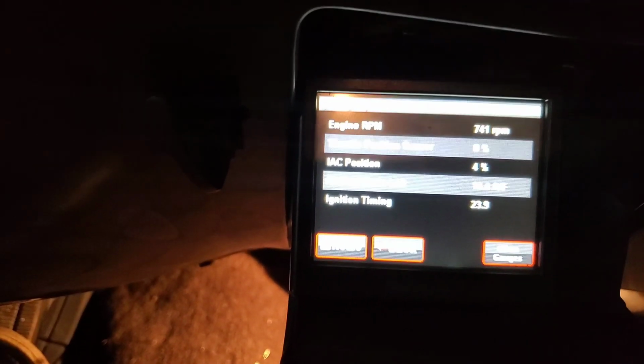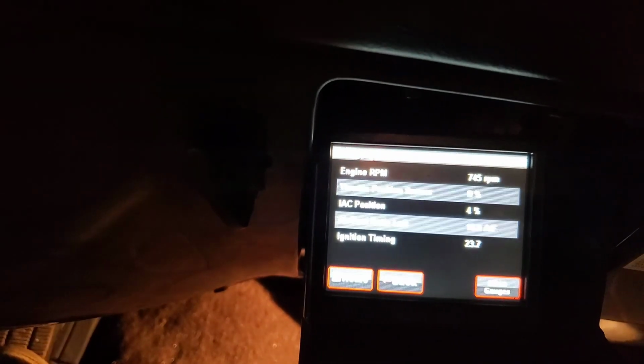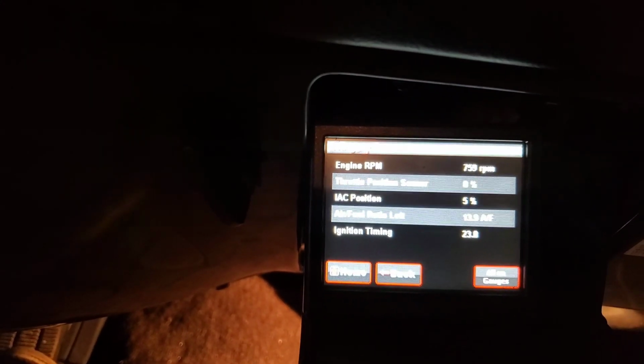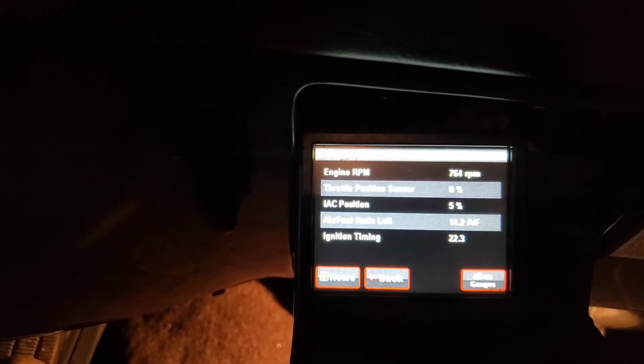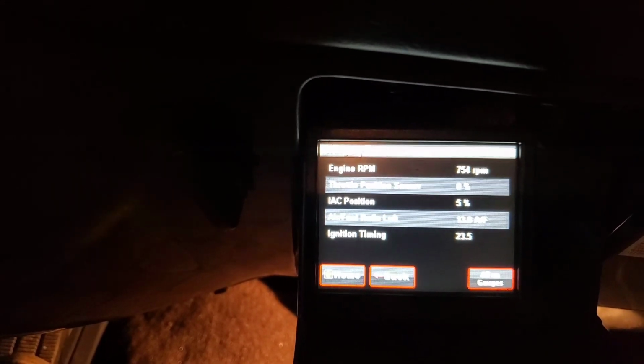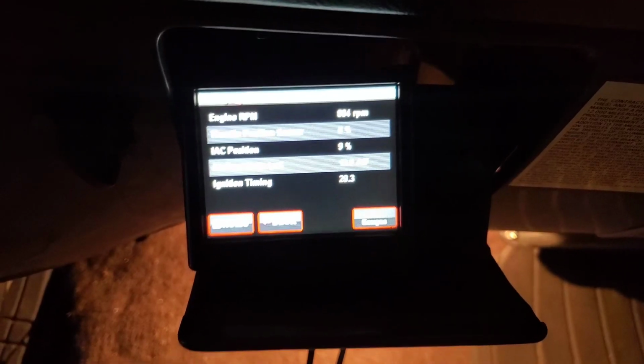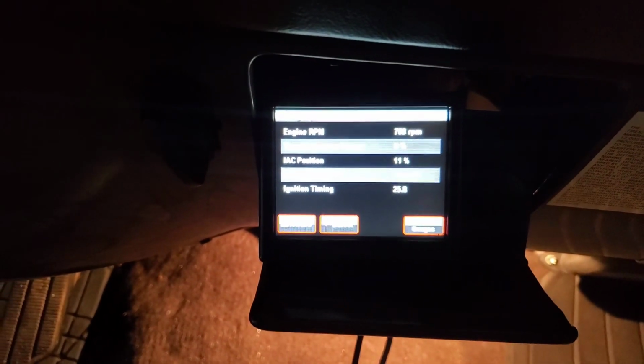And then as you turn the AC on the truck, or the alternator kicks in, starts charging, anything like that, and you put it in gear and it's up against a torque converter, then it's going to pull out the idle air control and give it some more air so it can achieve that higher idle that the engine's wanting. So far so good. Alright, so I'm going to kick the AC on.